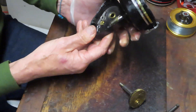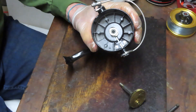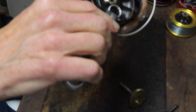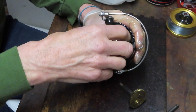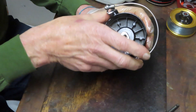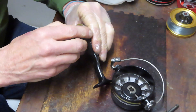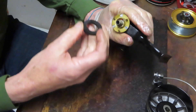This is the bottom of the case — it's very clean. We want to get to that spiral gear and the bearing. To do that we need to remove the rotor cup. I use an offset wrench here — you can't use a box wrench because of the lip on the cup, but this offset wrench works perfectly. Once I get the nut loose I like to take the rest off by hand, then remove the rotor. There's a little rubber washer thing here held by three studs — just be careful not to rip it.